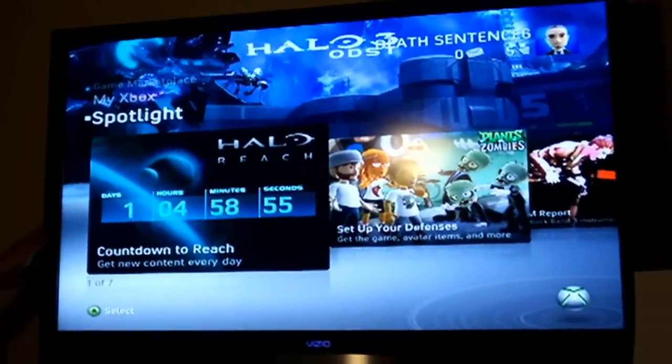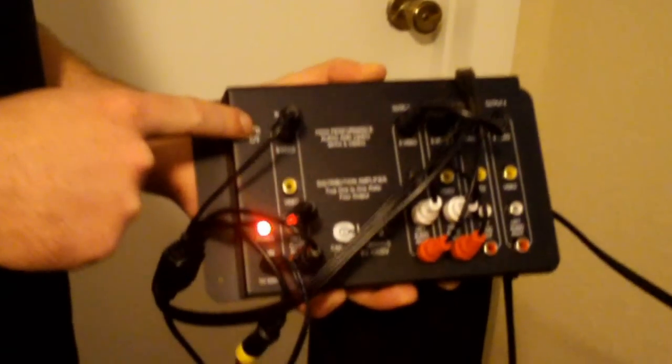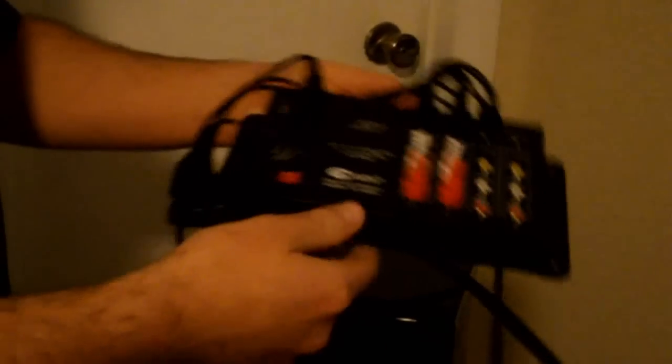I have the 360 going to my TV, which is right here. But before I hooked it up to the TV, I actually hooked it up to the splitter right here. You hook your S-Video from the 360 on your input into the amplifier, then you have output 1 and output 2. Output 1 is going to the TV, output 2 is going to the Pinnacle, which is right here, hooked up to the S-Video and audio, and then the USB is going all the way to my computer.